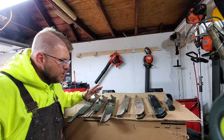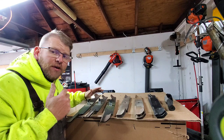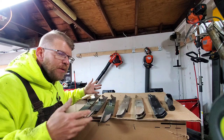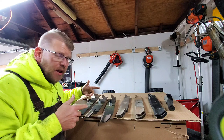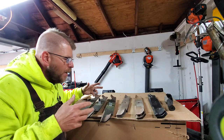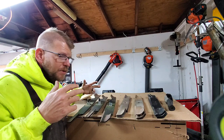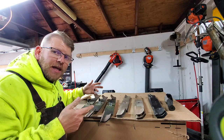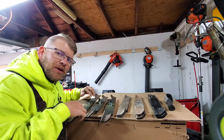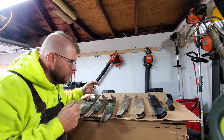All right guys, so we have a bunch of different blades here. I have a ton back here in the corner, and I also have a ton at our dealership, because our dealership, Schlabach, they actually run a program where you can pretty much bring your blades in real quick. They'll put another set on, take your old ones, and then sharpen them until you come back, whenever. They have that program. So we actually have, I think, 10 sets out there also, between our 6000, our Grandstand, and even our X-Mark that we take out there to get service, because a lot of people don't know, but the newer X-Mark and Toros, the blades are pretty much exactly the same. There's not a real difference in them.